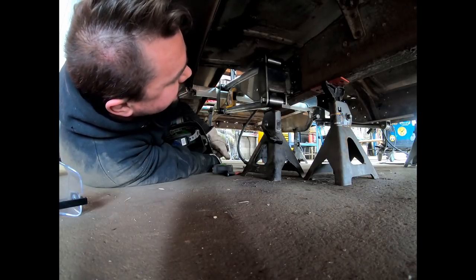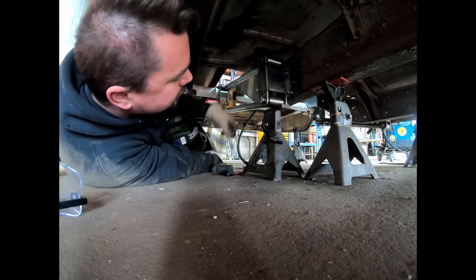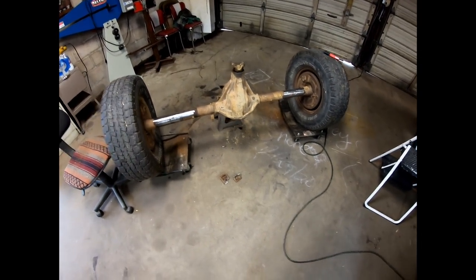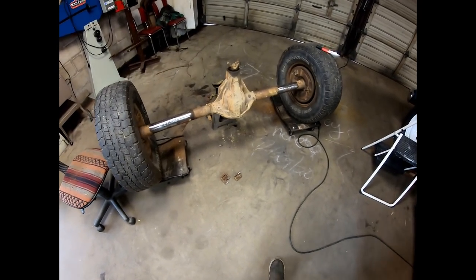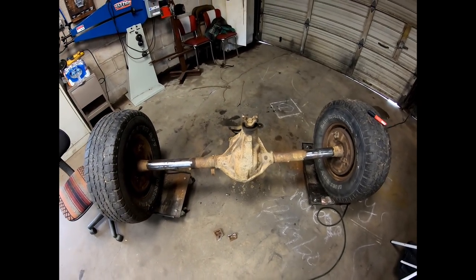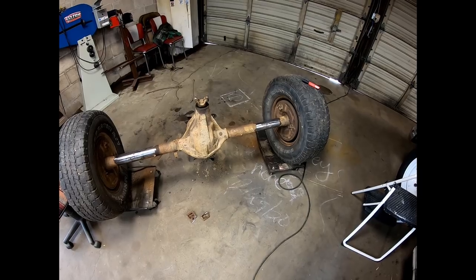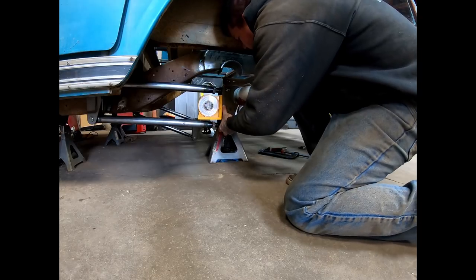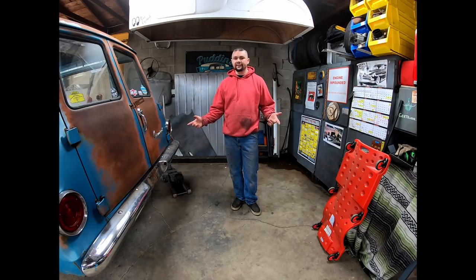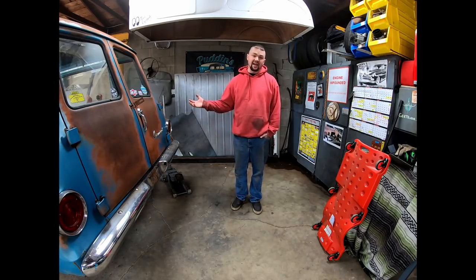I put three fat tacks front and back — actually welding it a bit more since we're going to cycle this without full welding, so we want to make sure it won't mess up. I got the rear end cleaned up. Long story short, the Astro van rear end is not going to fit, so after pulling my head out of my ass I decided to just use the factory one. I got all the brackets cleaned up off of it and got everything slid up in place, but nothing tacked to the axle yet.